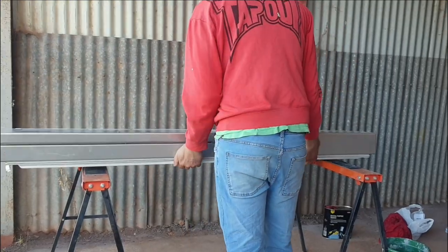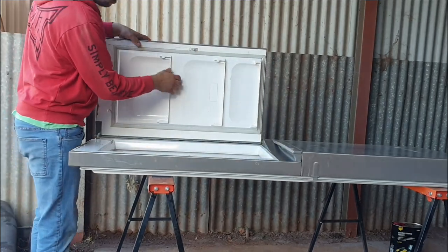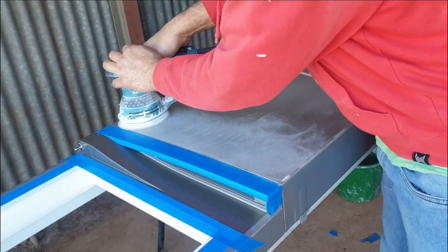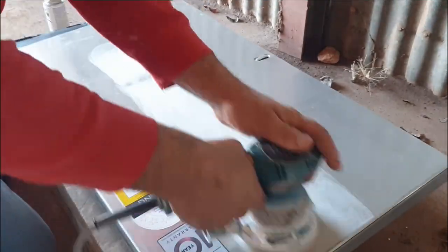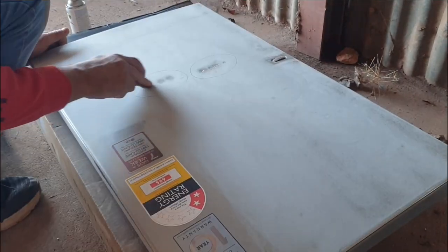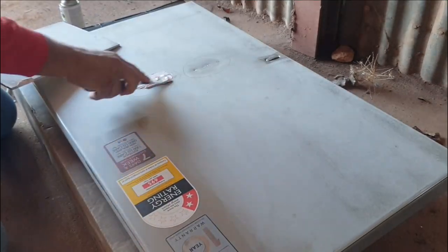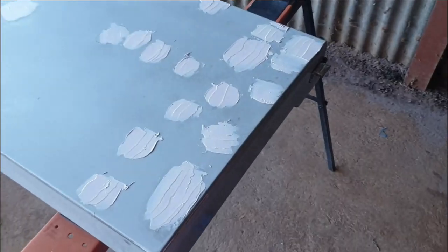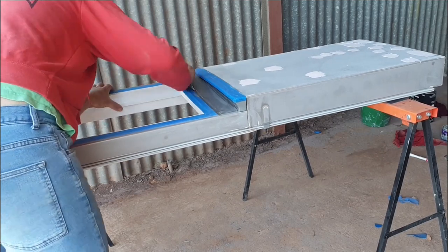Time to get onto the second door. This is two doors in one so we decided to separate them to make it a little bit easier for masking and painting. Same deal — 320 grit everywhere that paint was going. We did decide to take the stickers off the door to make it a little bit easier for painting. This one I didn't use the grinder — I just got some sandpaper and got into the dips just to give the bog something to edge to. Again using your hand to get into the areas that you can't get with the orbital sander.